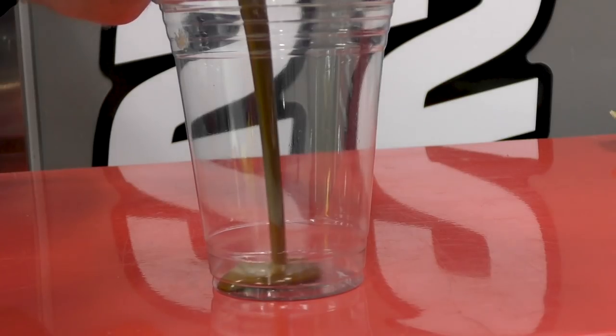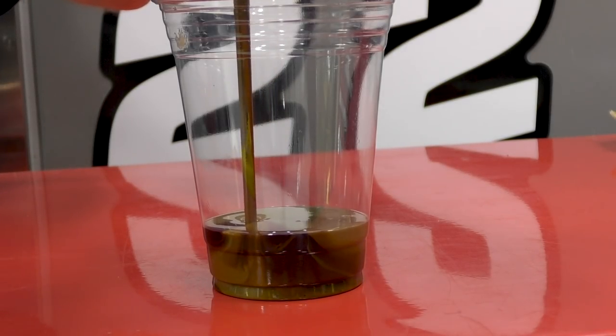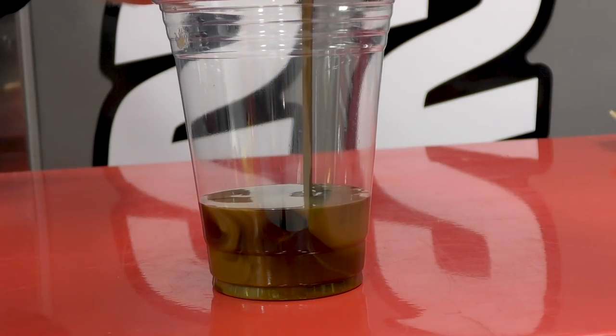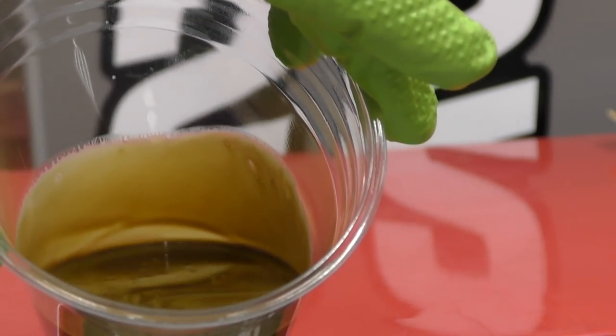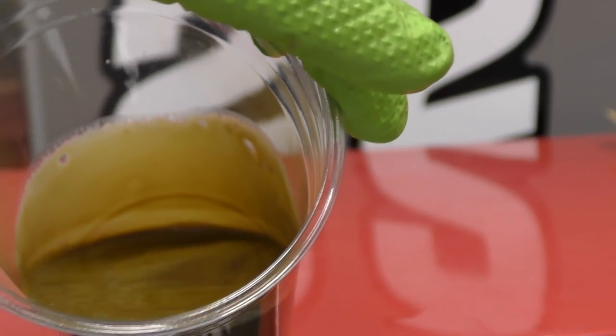Then we're going to take a straight edge and take some measurements. Something else we want to keep in mind when talking about making this repair is the consequential damage potential. How long has this been going on with coolant mixed with oil? When coolant's mixed with engine oil, it'll reduce the lubricity and the lubricating properties of the engine oil, so we might actually have more damage than just a head gasket in the form of damaged bearings or whatnot. It's going to be up to the customer how deep we really want to go. Questions, comments, drop them down below. I'll put links to some of the stuff we used today down in the description. With that, I'm out — have an awesome day and I'll talk to you again next time.